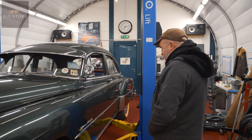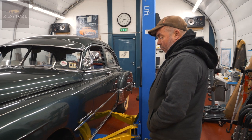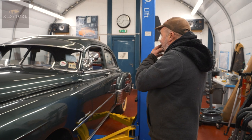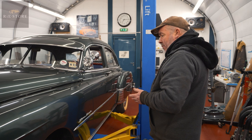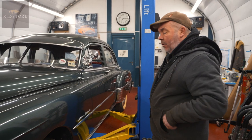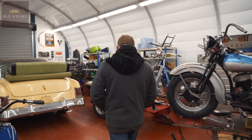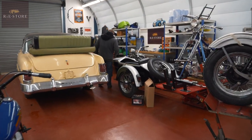The customer wants the brakes sorting out because they're binding and not working properly, so obviously pop the wheels off. I know that side front's binding and that side rear's binding. Fuel gauge doesn't work. Gear linkage is bad, which is not uncommon on these things because it's all just rods and bushes — all of that's probably worn out. He thinks the fuel tank could be leaking, but I think it was probably coming out of that pipe.